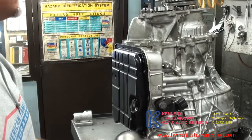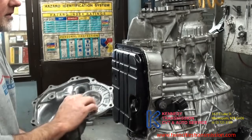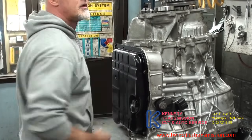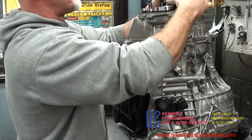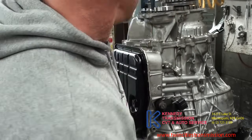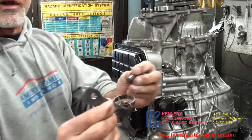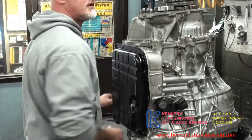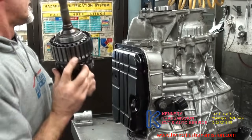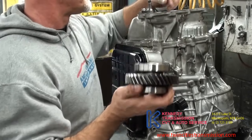Use your output speed sensor. You've got a shim — two shims actually. This is your transfer clutch. Let's take the parking pawl out. Transfer clutch right here — transfer clutches are in here. And there's the transfer gear.